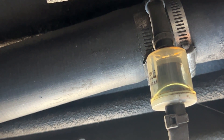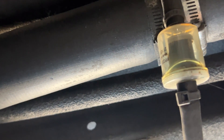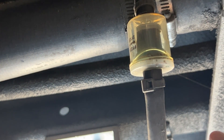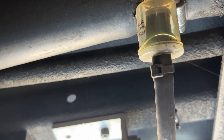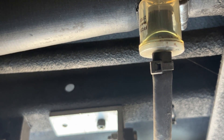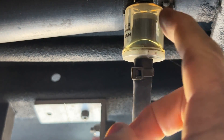Then we're going to draw a siphon through here into a hose, which I will connect back here. We're going to let that siphon run until all the air bubbles come out of the filter and through the siphon hose and into this little bottle that I've got. It's not going to purge that filter out completely because the fluid's going to be coming down. Then what we're going to do is hold the bottle up above this level so it'll back flow and push all the air out of the filter and out of the lines.